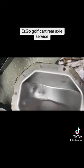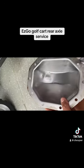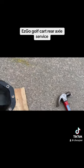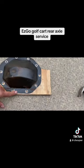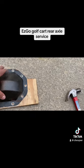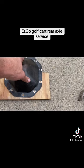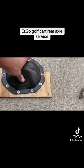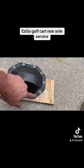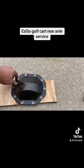I'm going to clean it, scrape it, get it ready. And from there I might even paint it. So here's the cover, and what I just did is I squared up — made this edge flat again using this piece of wood as a reference point. It doesn't have to be exactly perfect and square, but you can just rotate it and see if you have any high points. And like I showed you in the previous clip, I did have this area raised a little bit — not anymore. You can see it's nice and flat.